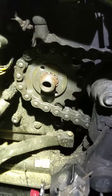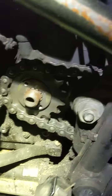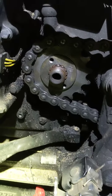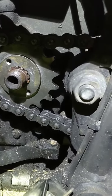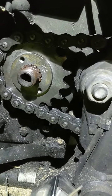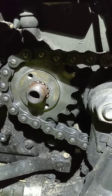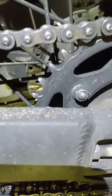What I find — no matter whether I'm running a 16 like here or a 15 — if I keep an eye on the wear on the teeth, once that square top on the teeth and what looks like a little bit of an arc on the teeth, it's already too late. But that's the point where you've got to change out the front sprocket, so you don't mess up the chain too bad, so it doesn't wear the rear sprocket out a little too soon.